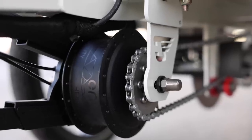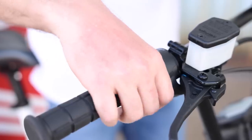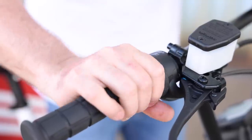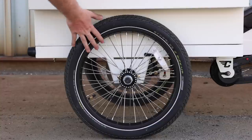For the drivetrain, it's a continuously variable transmission — a little bit different than traditional stepped gears, with no individual steps. I kind of equate it to more like a volume dial than a channel clicker. It works really well and is really easy to operate for even less-experienced riders. You can see the rear wheel — 20 inches, 48 spokes — with a really heavy-duty axle, certainly up to some pretty heavy weight loads.